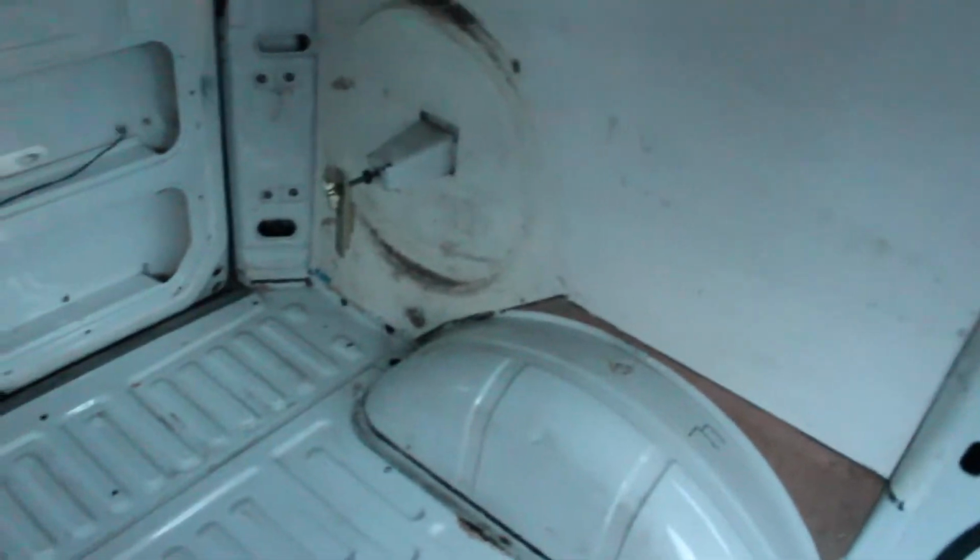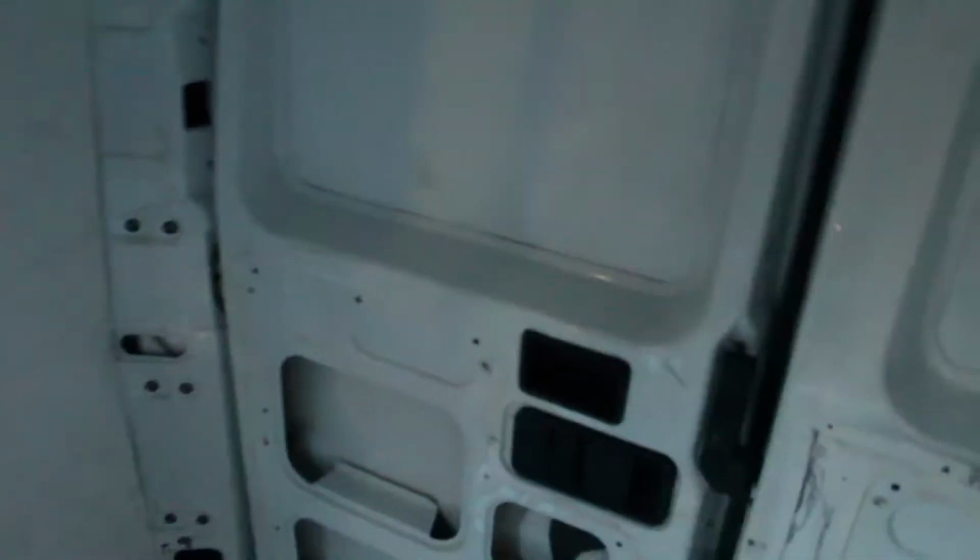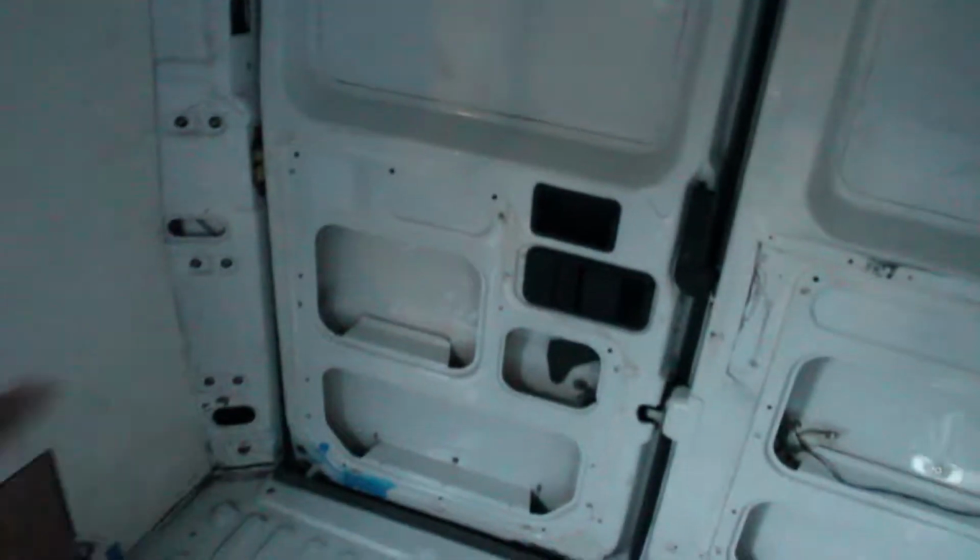But yeah, so we're going to seal and treat all the rust around the van, down there, probably all of the roof, and then once it's all watertight and sealed, then we'll start insulating it with mostly 25mm Celotex in here and the big areas and behind these walls, which we need to take down, and then the rest of it is going to be recycled plastic.